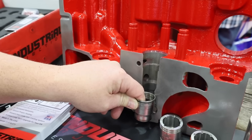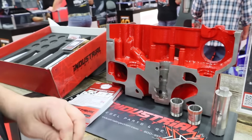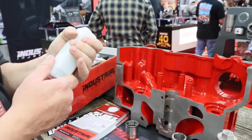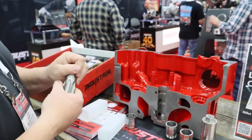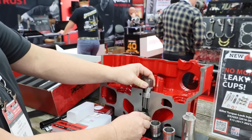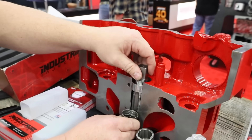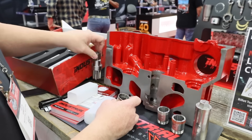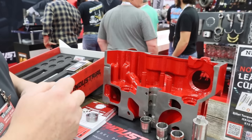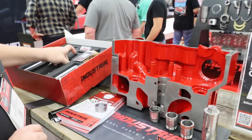You'll have a cup installed down in the bore that's been stretched and pulled, so we need to get it out. The first thing we do is go in with tap A — they're labeled, so you know which is which. You use the guide ring that comes in the kit, and tap A comes down in and taps the cup. You tap every cup along there, then put tap A aside. Once all cups are tapped, you blow out the threads.